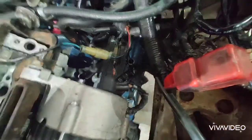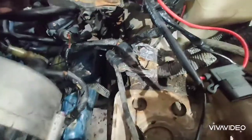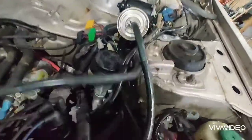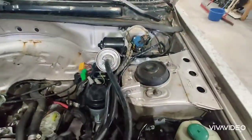We got to detach the alternator here because that is one of the few wires that runs on the firewall. Otherwise, you can just unplug those big clump connectors right there and those should disconnect most of the engine. Got to disconnect a few vacuum lines — we have this one here, it goes down somewhere and attaches here. We have this big line here, looks like a fuel line — that has got to get disconnected.